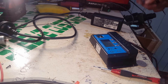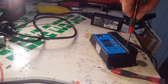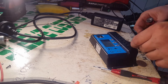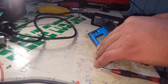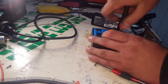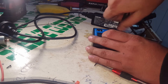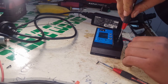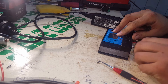My other battery charger — a lead acid car battery charger — is sitting out of my workshop. But I've got this one here, which is just a little PWM controller and a 19 volt laptop charger. I left the interior light on my Toyota van. I don't really want to go out there and jump start it because I don't really want to run it. I just want to, even if it takes a little while, just give it a charge up so it's ready to go tomorrow.